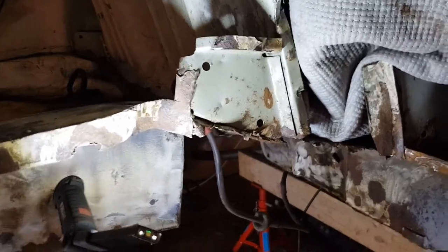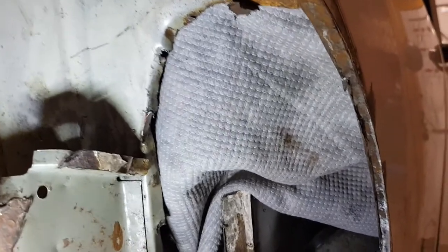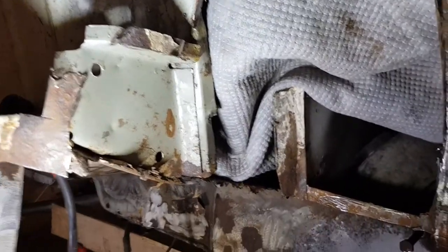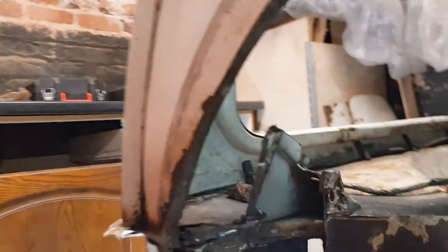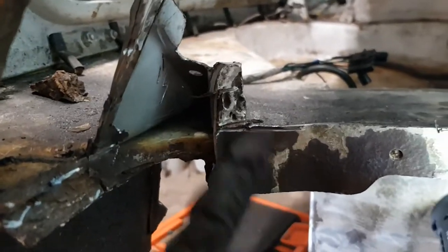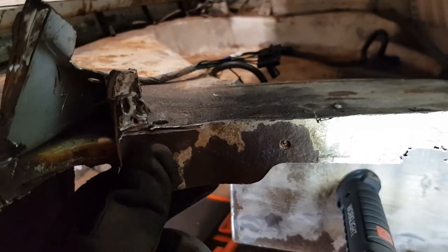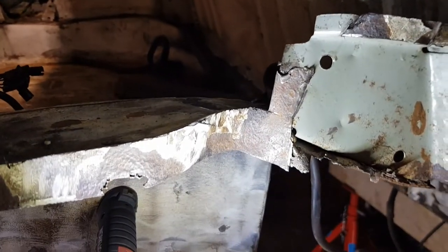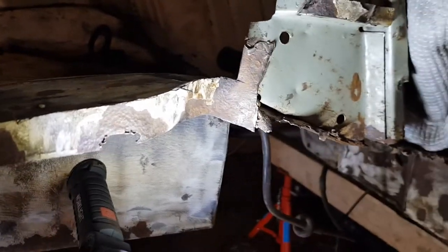It's now a few days later and I've been making a bit more progress. It's all unpicked around there - just a case of chiselling out the spot welds. I've taken all the lip off as best I can around the wheel arch, with a few bits to grind back where it's a bit fat. There's still some double skin stuff here I need to grind back. I might not grind this back too much because I might be able to use it since some of the flange on the boot floor is missing.